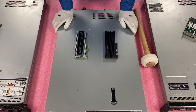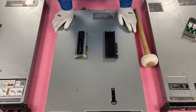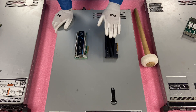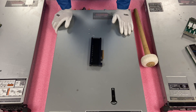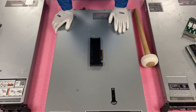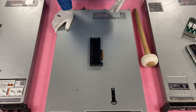With the U.2s, do make sure you have Dell firmware — you can't just stick a regular old Intel or Samsung NVMe into it. That's actually why with the PCIe, which we're about to do next, I wanted to show two different versions: a regular Intel and a Dell. With the R630, you cannot just pop in any NVMe — firmware is incredibly important, so the Intel one just won't work. Also make sure you have the right bracket — low profile or high profile — when putting it in. If you have the wrong bracket or no bracket, you can get dust and junk in the back.